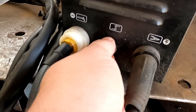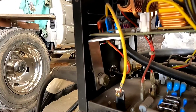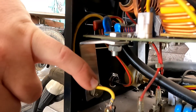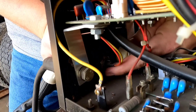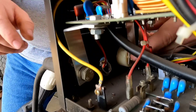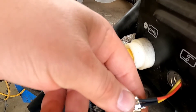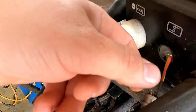To start with, this thing is loose already. If we look in here, you can see the back side of it and it's only got those two wires going to it. There's a nut back in there — now you can see it — there's a nut on the back side of that. I'm going to reach in here from the other side and loosen that nut with my fingers since it's already super loose, and drag this out. Now that this is off on the front side, you can see what I got. It's just two wires and it's for a switch, so it really doesn't matter which two you put them on for the new one, but it has multiple other pins that just aren't being used. So I'm going to get the soldering iron, strip this little insulation off, loosen that up, and just put them on the new one.